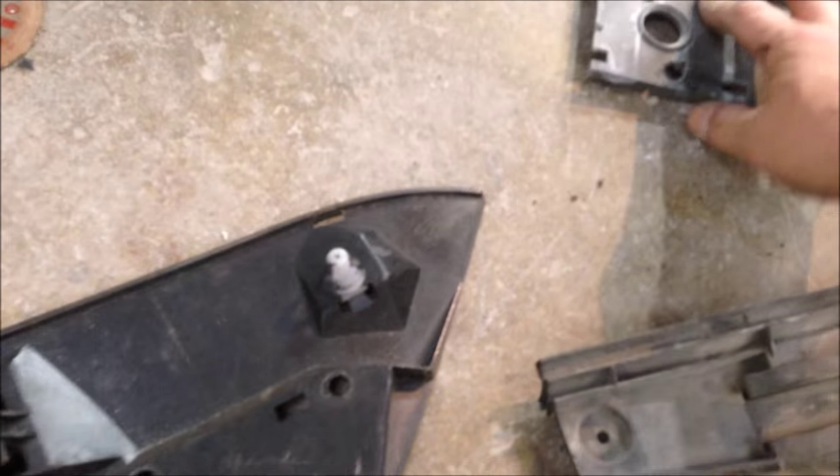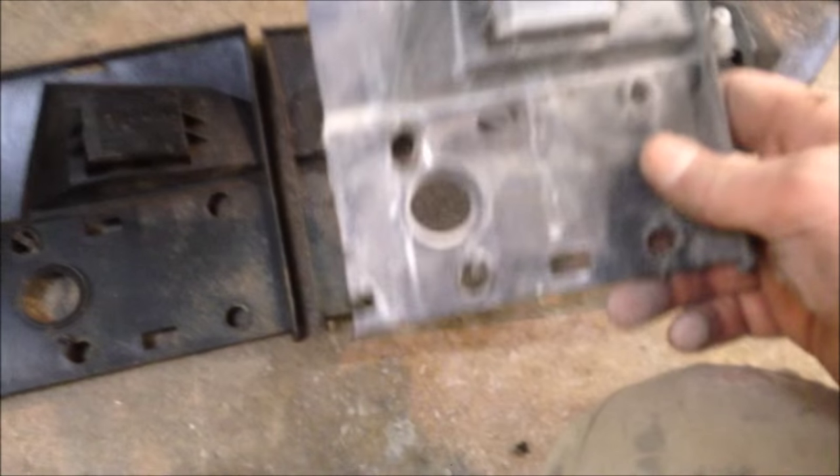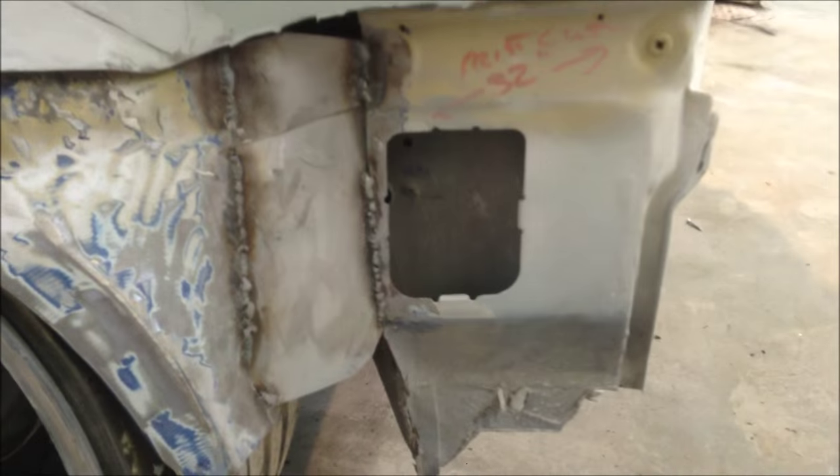Right, this is the plan then. So obviously we've got standard Mark III bumper brackets. The sides, that's for the other side, so that's been cut already. As is that. That we're going to scuff up and bond onto the new bumper. That obviously just gets screwed into place as it would normally. This one will be cut down again like that. But we're going to retain these. We're going to cut this out flat, and then this little piece is going to bond onto the new piece of the rear of the Mark VI bumper, so then we can just make a slight hole here and it'll push straight in.